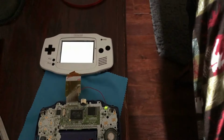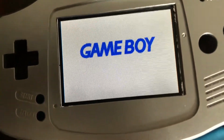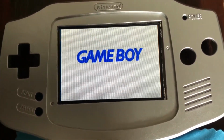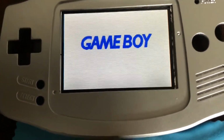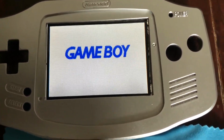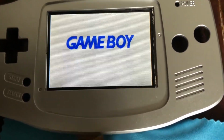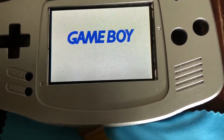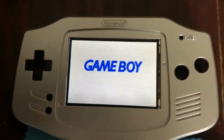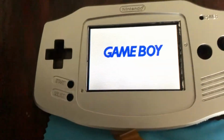Alright, let's see if the screen will still work. And voila! I think it could be in the center. This should be centered, I think. The AGS-101 screen in the original Game Boy Advance shell seems centered. Just so you know, this is my first time putting the 4 adhesive strips around the frame of the Game Boy Advance SP. It's AGS-101 LCD.